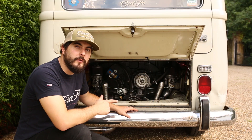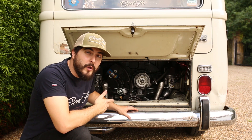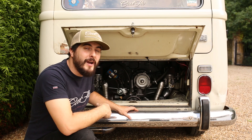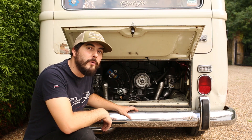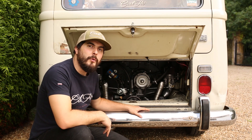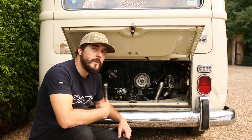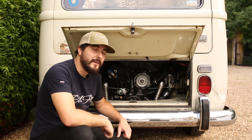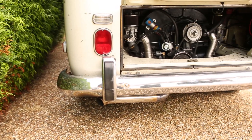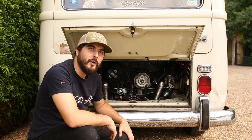One of my most favourite things about the bus is the engine. It originally came with a 1641 when we bought it — unknown mileage — and unfortunately it died when we were in the US. A week before Christmas, snowing, with two weeks left on our visa, we managed to get one shipped up from California. It's now a 2110cc pushing just over 100 brake horsepower. It has big valve heads, a Scat C35 cam, and twin Dellorto 40s — bags full of torque. It really goes up hills; I can actually accelerate up hills now. It's not a screamer but it's a really good cruising engine, which is perfect for what we do — long-distance cruising.